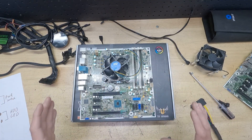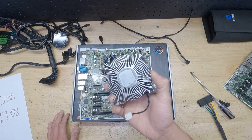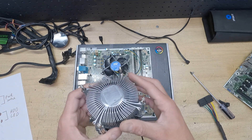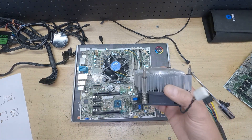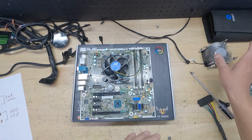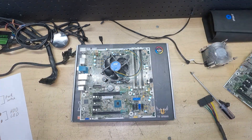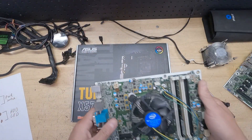So let's talk about your options and what adapters you're going to need. First thing: CPU cooler. The stock CPU cooler that comes with it works pretty good, but the issue is that the screws to mount it are part of the case and you can't take them out and reuse them. What I've done is get plastic nuts from the local hardware store, bring the cooler with you, find the thread pitch, and I'm able to reuse it. The other option is to use old Intel CPU coolers — I keep those lying around. You can also upgrade to a Noctua, Be Quiet, anything you want. It's just regular standard mounting, nothing fancy.